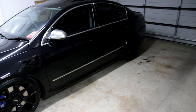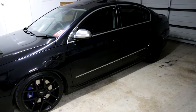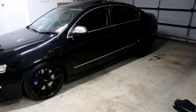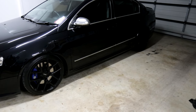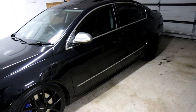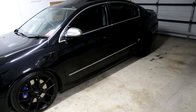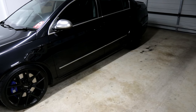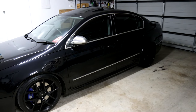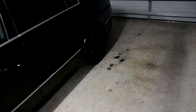What you're going to end up with is a fair bit of space around the muffler. What you can do is exactly what I've done: get a cheap two-and-a-half inch eBay valve, weld that in, and then wire it in yourself. To get that center res delete, I've seen quotes from anywhere from $120 up to about $160. That valve was about $120. So let's say $300 Australian dollars to achieve those results I just showed you, wiring it up yourself, which is super easy for these cars.